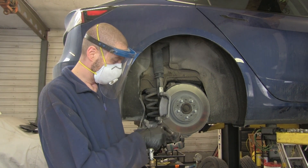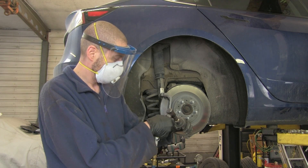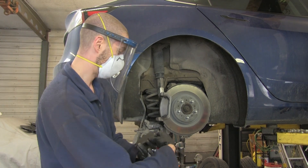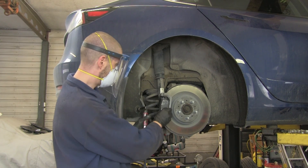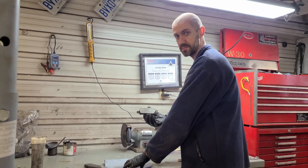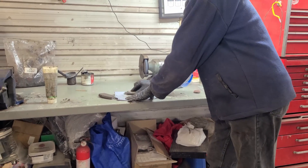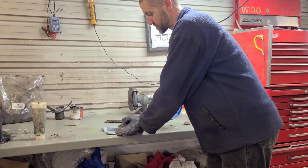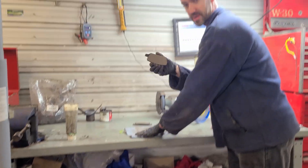Okay, now we're going to do the other brake pad. Shiny, looks good all around. If it's your first time, take the brake pad, stick it to the bottom part of the holster first where it springs in, push it in, and make sure it moves by hand. If it moves by hand, you did a good job. One more thing you want to do for a brake service — you want to sand the pads just to get a little bit of the rough edges off. Take it on a flat workbench and just work it around so you remove some of the material. It looks like a new brake pad when you're done. Do the same to the other one in different directions, working on a flat surface, so you remove a bit of the surface and it looks new again.